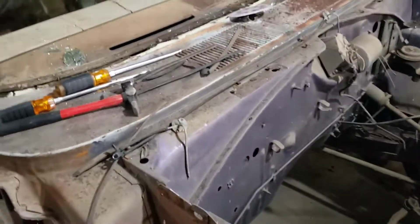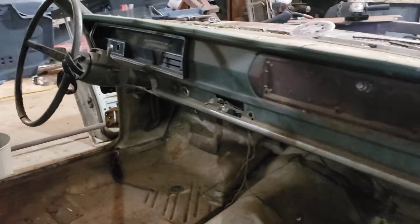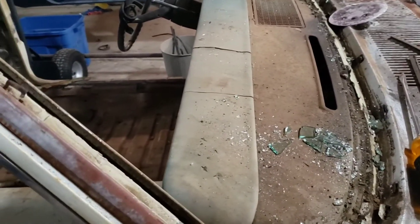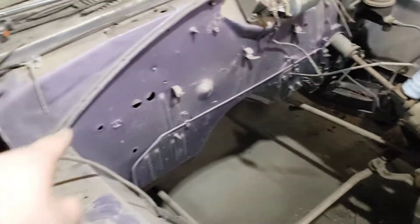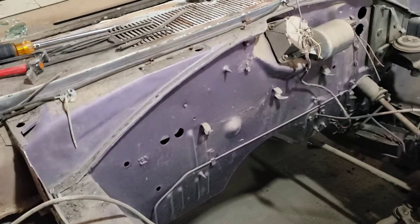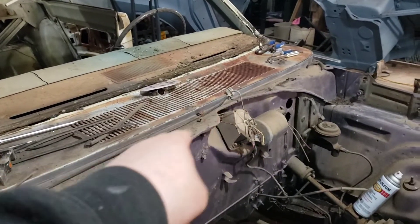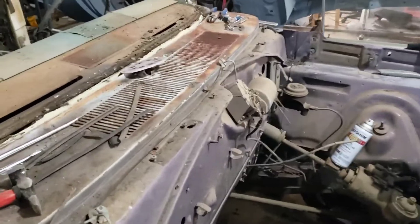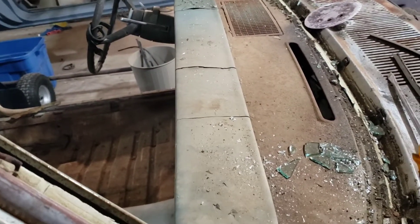It's going to be pretty easy going forward now that that's out of the way. I'm going to drop the steering column down, and then I have access to the bolts for the dash frame, so I can rock that down and then undo all the plugs and wiring and miscellaneous stuff. It looks like the heater box and everything's already out, so that's not a big deal. Then I can access underneath all the wiper linkage and get the wiper motor disconnected from the arms and pivots.